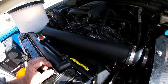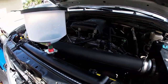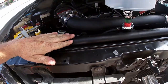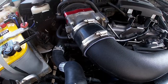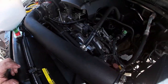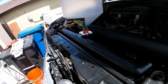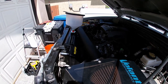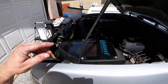It started! Now we just have to let it warm up and get up to operating temperature. Check the coolant — you can see it's circulating now. Make sure we get it pulled all the way back up. Once we take it for a drive I have to check the transmission fluid, since we changed the radiator and the cooler drained. I bypassed the transmission cooler inside the radiator and just ran to the external transmission cooler. Hopefully that'll be good enough — if not I'll add a fan to help cool it. Sounds really good — it's good to see it running. What a job, well done — another DIY Willie project!